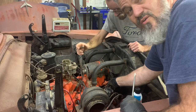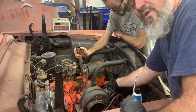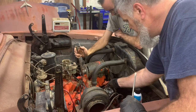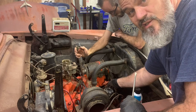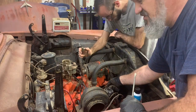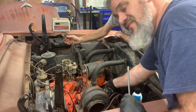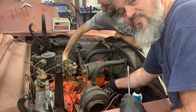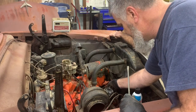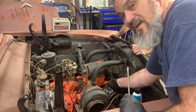Right now I'm just putting a little emery paper on the points. A lot of people out there don't understand the way points work because it's just such old technology compared to what we're dealing with today. If you have a car with points you probably already know how it works, but sometimes you get an old one like this. Just put a little emery cloth between the points and clean it up, and it might get you where you need to be.